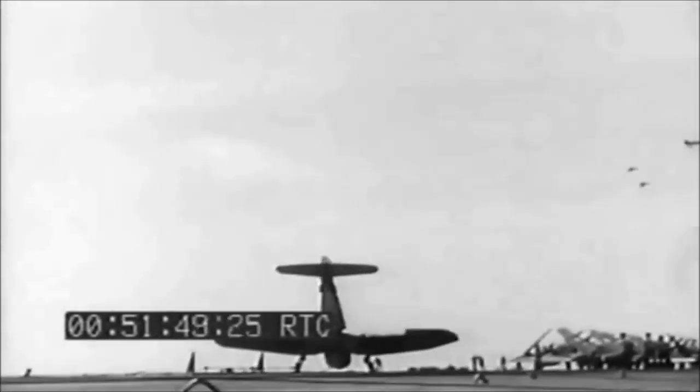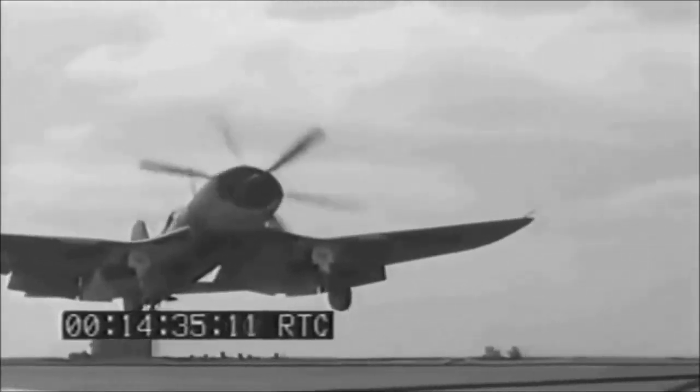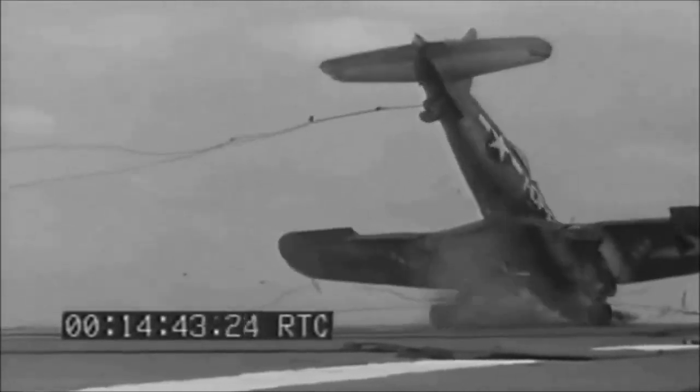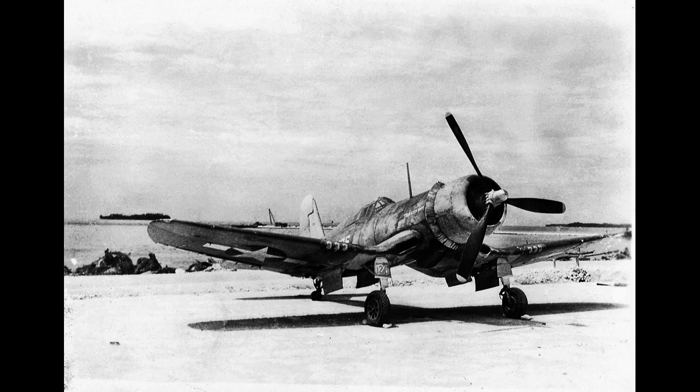In similar crash landings with the Corsair, I never once saw broken gear, and the plane seems to hold together really well. The Corsair's fuselage doesn't have enough girth to mount the wing low enough for the gear to reach the ground, at least not if it's going to be short enough to retract into the existing wing and double as a dive brake. However, there is another issue, and it's related to speed.